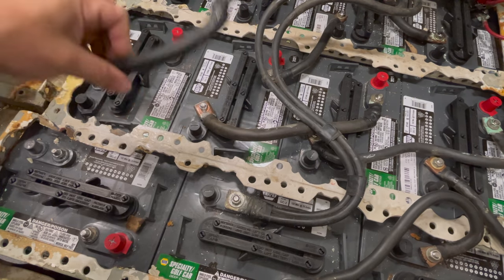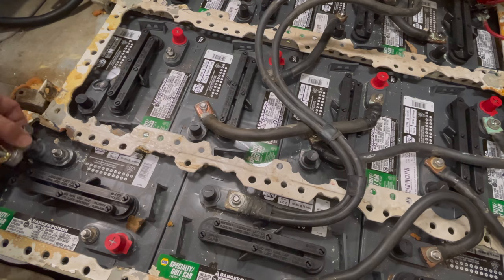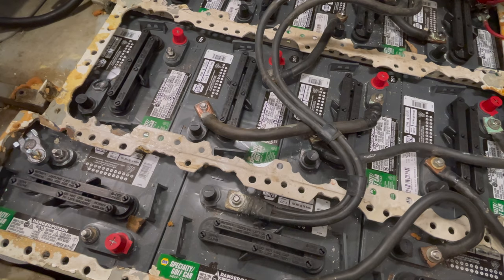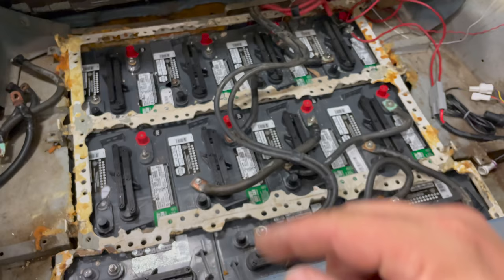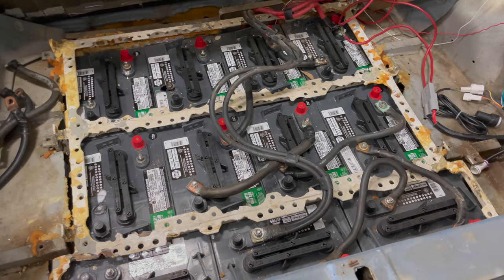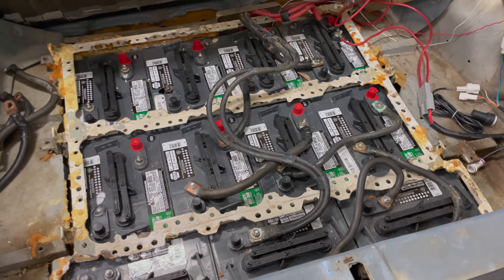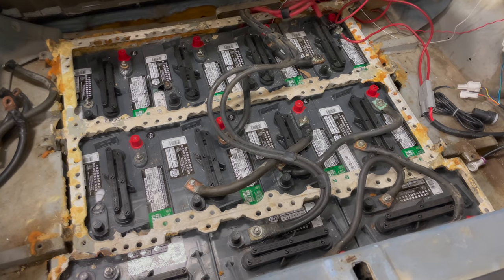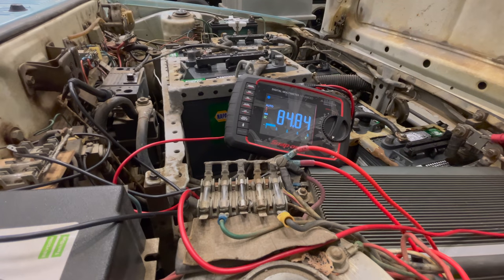I'm not really sure what's going on with these batteries. I don't know if my theory about the cables being bad is correct — maybe it's a case that they don't make batteries like they used to. One thing I'm thinking about is using a terminal that lets me double up my cables to provide two connection points to the batteries, hopefully preventing it from melting. Maybe something like what I'm thinking already exists — if you know, or have other ideas, comment below. I drove back to the shop with four batteries disconnected and the car still drove fine, so I'm going to check the voltage now after a 20-25 mile trip to see how discharged we are. It looks like we're down to about 85 volts.